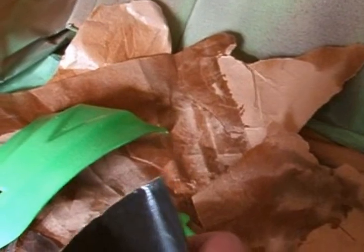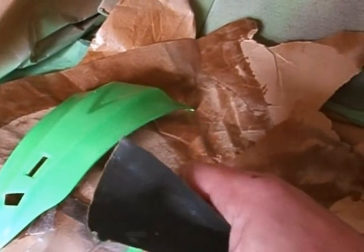Because paper is harder than plastic and paint, the paper shouldn't wear out if you use water. I've added a little bit of soap for two reasons: soap makes it more slippery, helping clear anti-clog build-up; and soap is a detergent which removes grease. Having a detergent solution when sanding means you've removed all the grease so the paint will stick better. If you have a grease spot under paint, the paint crawls away from it — creating what's called a fish eye.